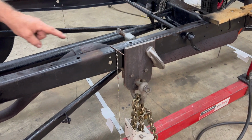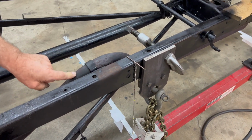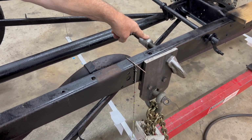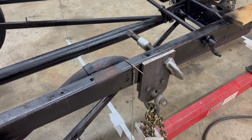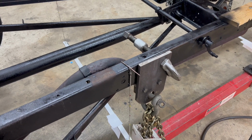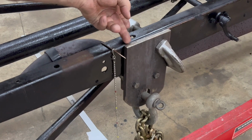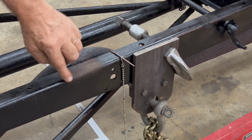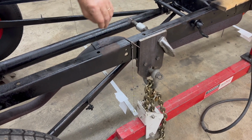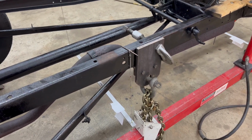Normally, this exhaust pipe is on, it's way too high. That's not normally where it goes. It's supposed to be on the bottom flange. And so normally I have two of these clamps, and I put one on this side too, because what that's doing is getting hold of the flange and the web inside the frame. What I'm doing is I'm pinching it, and this plate actually has a hook on the top of it. You don't notice it. See the radius here? I made a deal there so when you tighten that up, it's got a hold of this up here too. So it's pulling when you're pulling down on it.